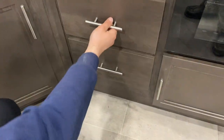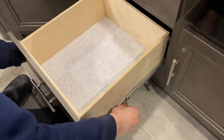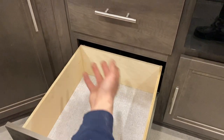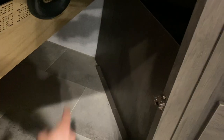If you're looking to winterize the unit, this drawer right here is what will come out. It has two little ears on the side — push one down while the other goes up, then pull the drawer out to get access to your water pump back there. A winterization kit is already installed as well. Alternatively, there's one panel here with three screws in the bottom — pop that out and you also get access to it.